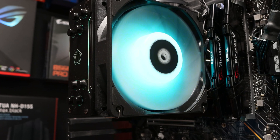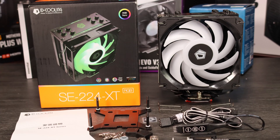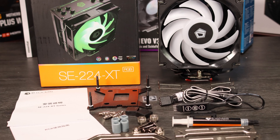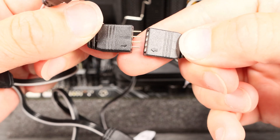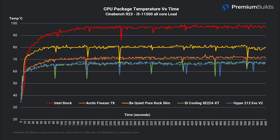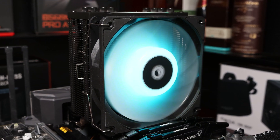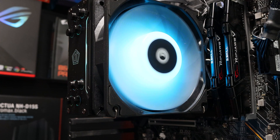The alternative is the ID Cooling SE224XT — also a 4-heat pipe cooler with a 120mm PWM fan. It's clear that ID Cooling have really thought this product through whilst prioritising the value on offer. They've been inspired by Noctua's mounting method: a simple, secure, and high-quality mounting system. There's a sheer range of accessories provided with this RGB-enabled cooler: an RGB splitter, RGB fan, RGB shroud on the cooler core itself, and even a standalone SATA-powered RGB controller module if you can't use the motherboard RGB headers. There's also a generous tube of thermal paste and brackets for an additional fan. Fitting is only complicated by hooking up the RGB elements. Performance is identical to the Hyper 212, with good temperatures under load and no undue noise. It's the value proposition that really impresses in the mid-range, with models ranging from a basic no-frills version up to the RGB-enabled one. If you want a decent mid-range cooler for the Ryzen 5600X or i5-11400, this cooler takes our recommendation with ease.